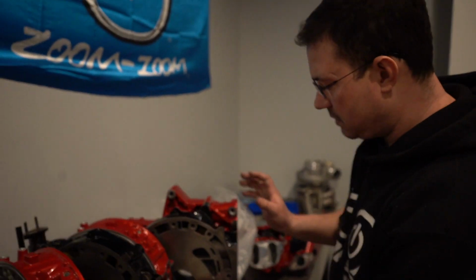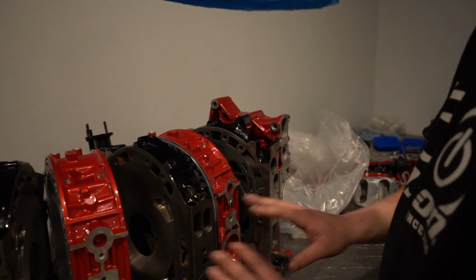And then, we do have our full bridge, so we're going to see how that goes. Also, we went one step further. Now I'm still waiting on my rotating assembly to get back on this, but we did do a double scallop on the rotor as well, quite large. Mainly was, like I said, the maximum amount of stuff that we could do to a Renesis to see if it does produce more power.